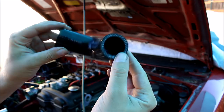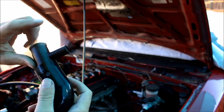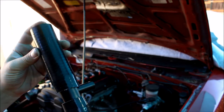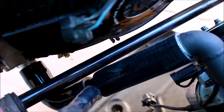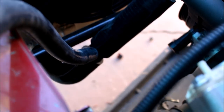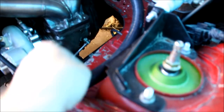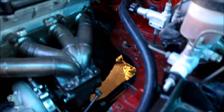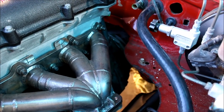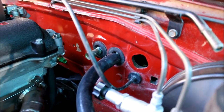My lower hose setup is just going to be an inch-and-a-quarter 90-degree silicone elbow, an inch-and-a-quarter tee that's got a 5/8ths coming out of it — this is going to be for the heater core — and then just another straight piece that's going to go right to the block feed. There's the lower hose setup and I've got my 5/8ths heater hose teed off of that. Coming up here I'll probably hook it up with some rubber mounting straps to hold it in place. I definitely want to keep it far off the manifold to prevent it from getting damaged or dried up and cracking over time. I'll put some kind of protective sheath on it right there and then run it directly into the heater core.